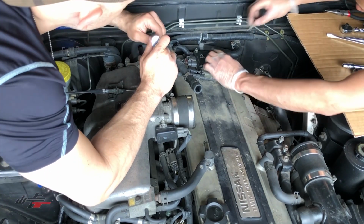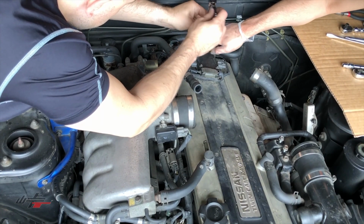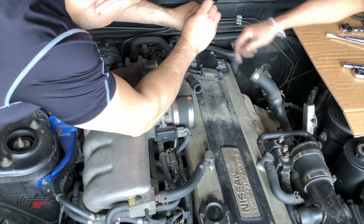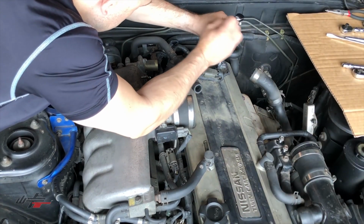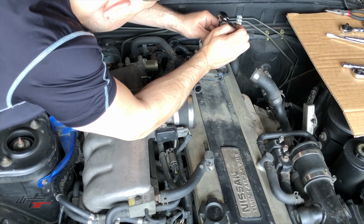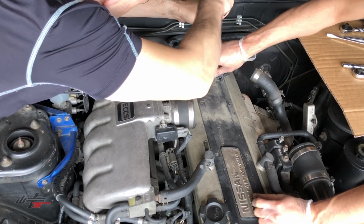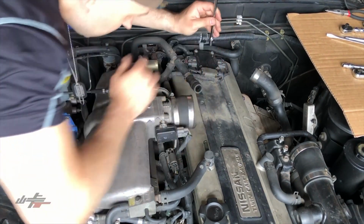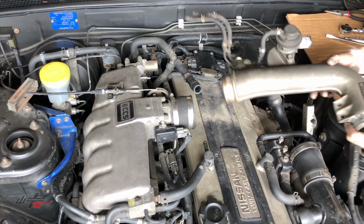And make sure you put the ground wire back into the hole over here for this one, and also make sure that the igniter's directional arrow points forward, and you can't really mess that up because everything kind of plugs in and bolts in only one way. So nicely getting back together on that igniter. Everything is snug, great, perfect.